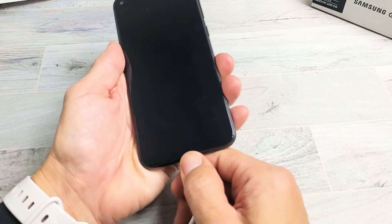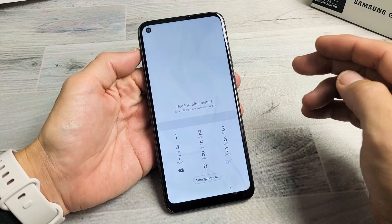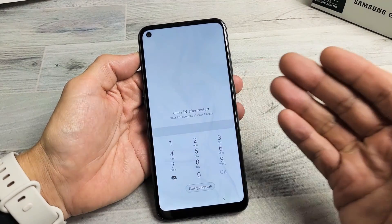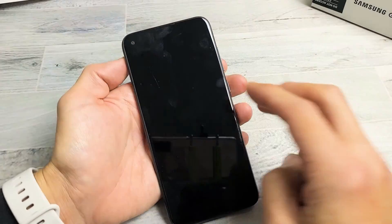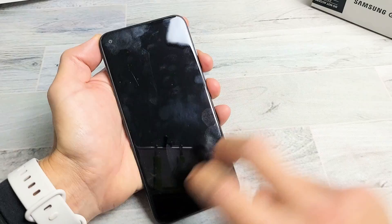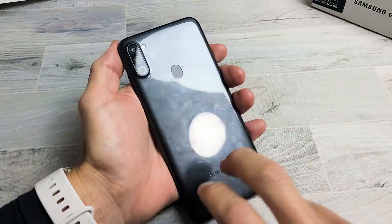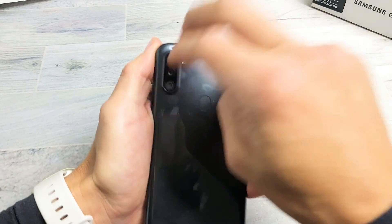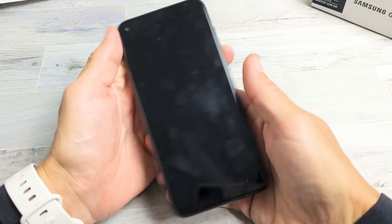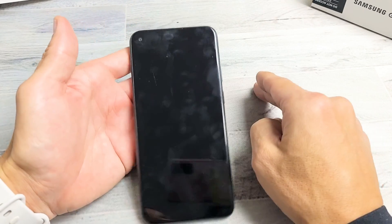If you're still down, we're going to go to the fourth option — what I call the tap method. We're going to tap all over the screen and all over the back. Because if you ever dropped your phone and that caused the black screen, a lot of times something is dislodged very slightly, and when you tap it, it can go ahead and put it back in place. Use two fingers, hold it like this, and tap kind of hard all over the screen. Sometimes as you're doing this you might see some flickering or white lines, or sometimes it'll just pop right on. If the phone doesn't come on, turn it over and do the same thing on the back — tap all over, around the lens, around the fingerprint scanner. Then force it to restart: volume down, power button, press and hold both buttons, do not let go until the Samsung logo appears, then let go.